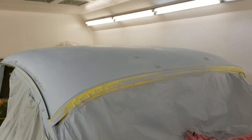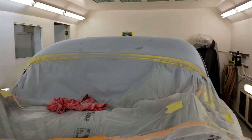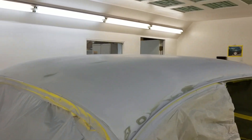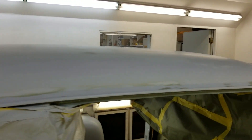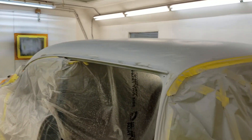This is a big piece of real estate on the top of a sedan. Tri-5 Chevys are known for a very big, large roof — that's a lot of area to cover and block, and they're not fun to paint. You have to stand on a board and run up and down it to shoot it that way. You can see where I was in the back, climbing in to block the back corners. This car will be painted over the Christmas vacation, but I just wanted to give an update on this particular girl.